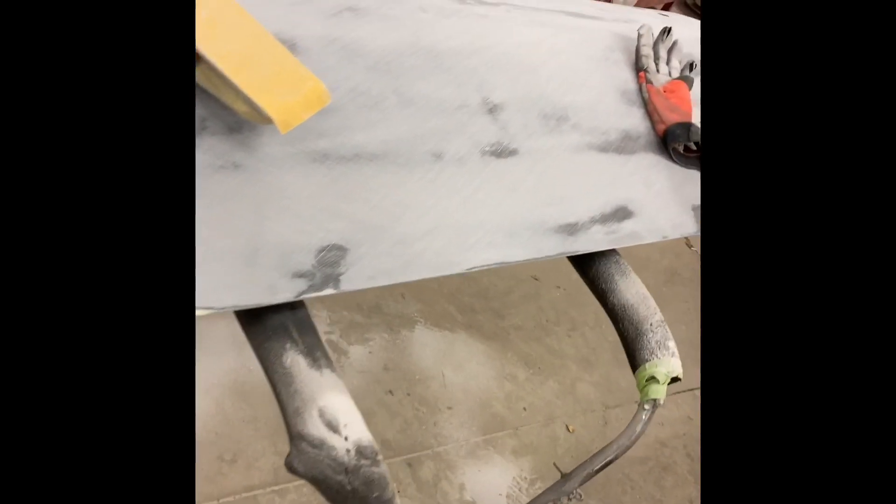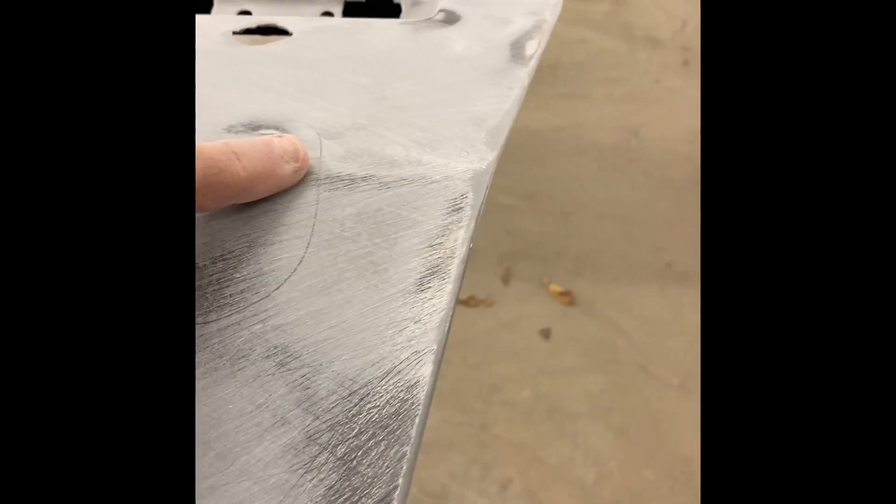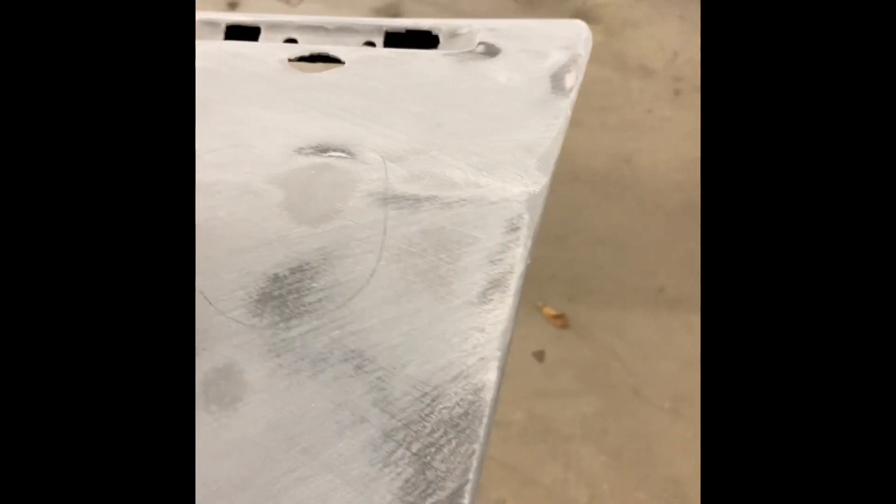That's why you see all that stuff. I went over the body — the body's done, trunk done. I did this door. Same thing — it actually has some epoxy showing through in a lot of places. I've got one light one there and one good one here I totally missed, so I might put a little swipe of Bondo in there. But everything else is straight. The fenders have a couple low places, but the tops felt good. We'll see how it looks once I sand them.